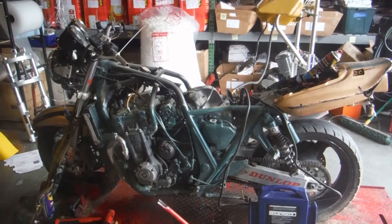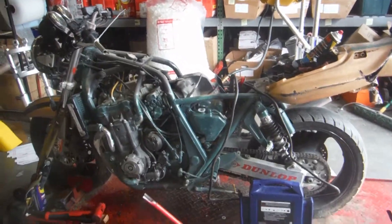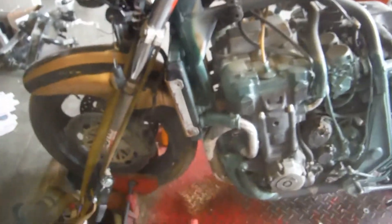Alright, here we have a '94 CB1000. This bike is being dismantled for parts today. I was able to get this bike running — the motor didn't sound bad — unfortunately, I didn't notice it until I got it running, but there was a crack in the stator cover and a small piece of the block itself is broken. So I'm going to try and get this bike running for you again, but I'm only going to run it for a real brief second just so I can show it running.